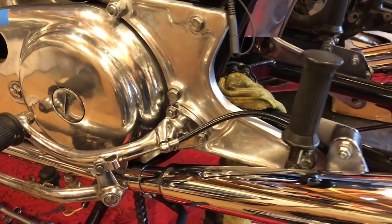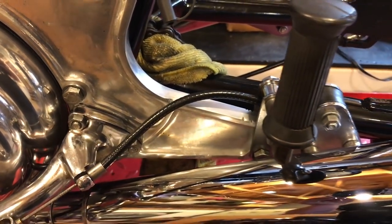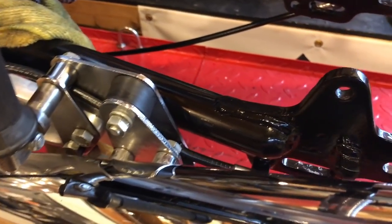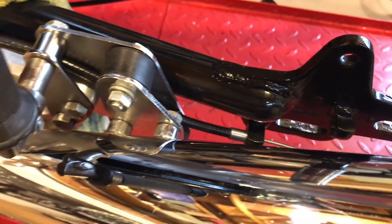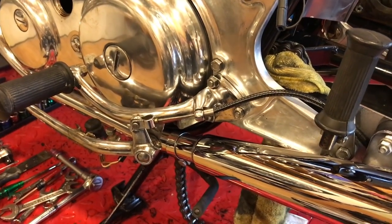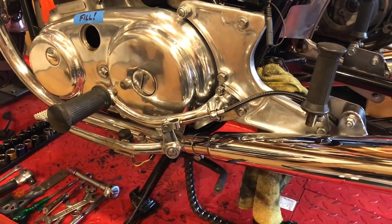The brake cable goes over the Z-plate, and I loop it through, actually, on its way to the back brake mechanism. I still haven't got that safety spring. I might get that online. That just stops your foot pedal dropping down and sort of jackknifing on the road.